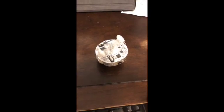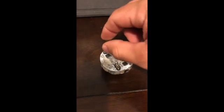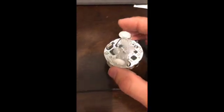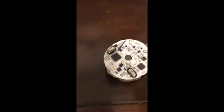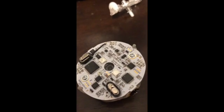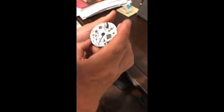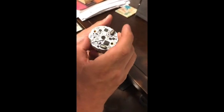I've got the controls, electronics, and motor all out. First thing you need to do is just twist this out — it pulls right out. You have to twist it around the antenna but it does pull out. Then we're going to remove those two Phillips screws next. Just gently wiggle the board up and rotate it until she comes loose.